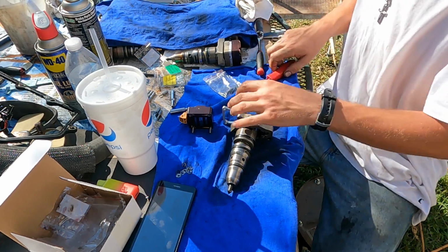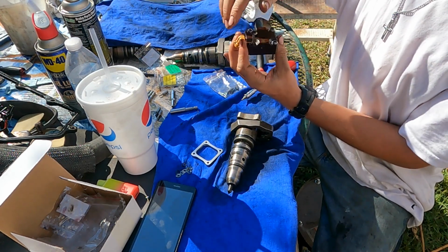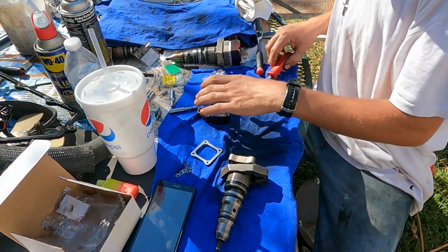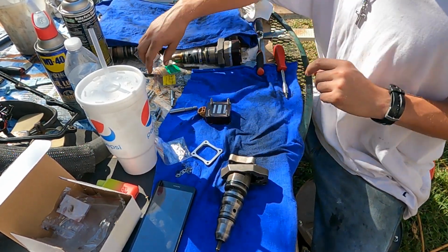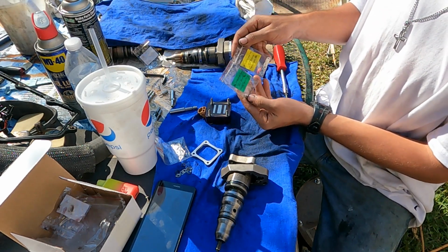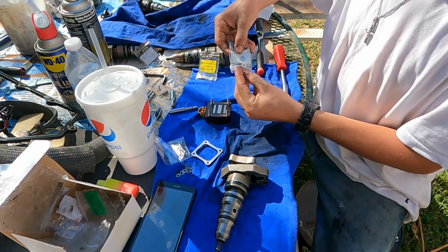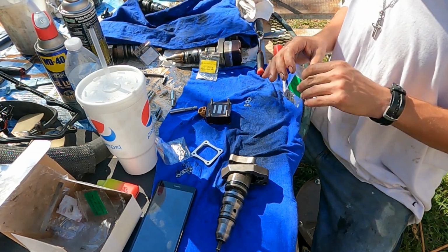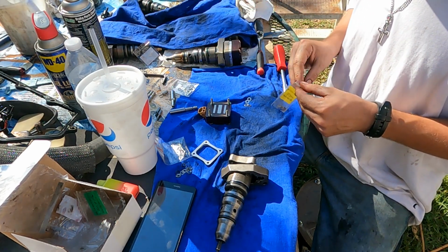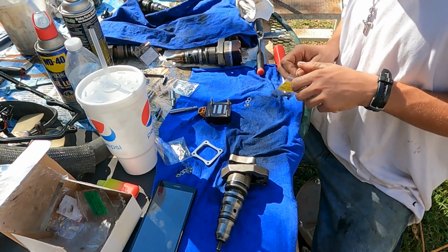Okay. We'll retrieve our bolts. Put them back in. And double shim them one more time. Go on with the 0.3s and 0.2s, making it 0.5s. Okay. 0.2s. And we ought to be in good shape.